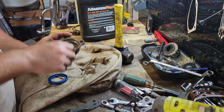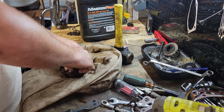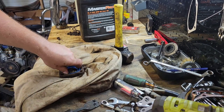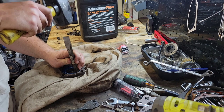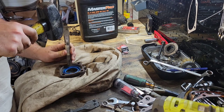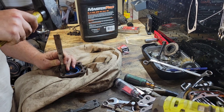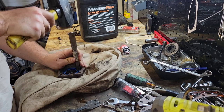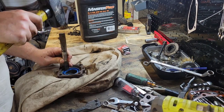There's your washers — the big one, then the smaller one, then your seal. We're going to work on getting it set in there. Even though it looks like it's all rubber, it does have a metal collar encapsulated inside — it's a very tight press fit. I'll use the big end of a chisel until I can get it recessed down in there. When it starts going in, I'll put that spacer back in there to help keep the seal centered and get our depth set right.